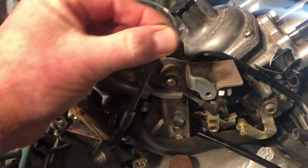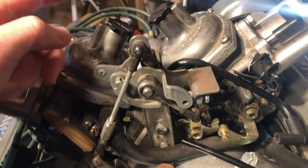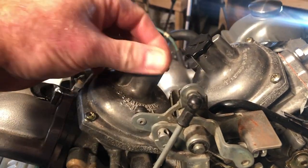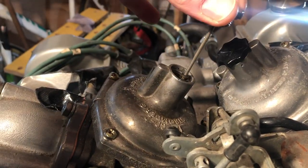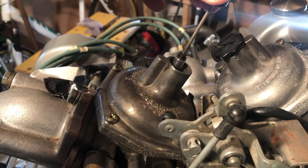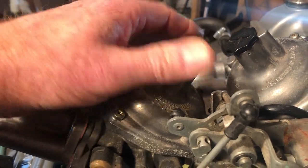Here's the linkage that you can see under the bonnet — that's your throttle linkage on the carbs themselves. You've got your dashpots on top here which undo and should be topped up with oil from time to time, just to make sure that the plunger is nicely compressed. You can see there's some oil in there which is positive news, so I'll just re-screw that back up.